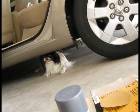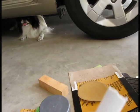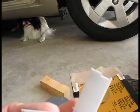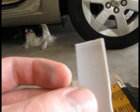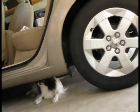I'm going to use this one to shape the applied seam sealer so it will match the factory one, and this one to apply the seam sealer to replace the broken part. Before I start doing that, I'm also going to secure the repair area so the seam sealer will only go to the designated place.